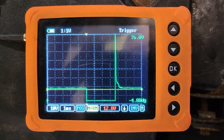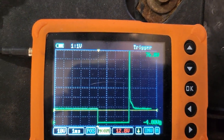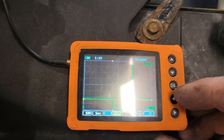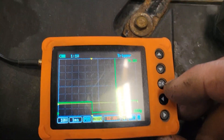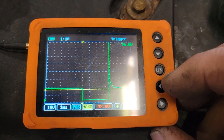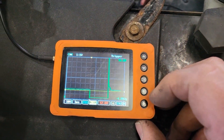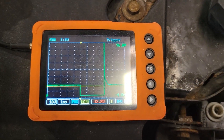I'm going to move the probe and compare them — see if there's any difference. That's a good injector, it's not acting up at the moment. That's the number two injector — it's almost identical. We can see the same pattern, the same injector closing. That's about all I want to run it — it's getting close to the maximum voltage of the scope and I don't want to push it too much, but this unit's been pushed quite a bit. It's very intermittent — about once every six months it does it — so I doubt I'm really going to find a problem right now.